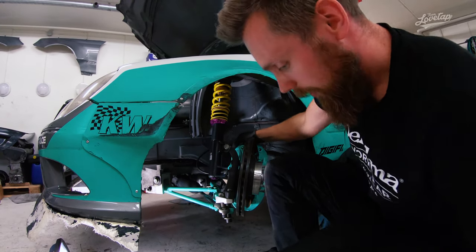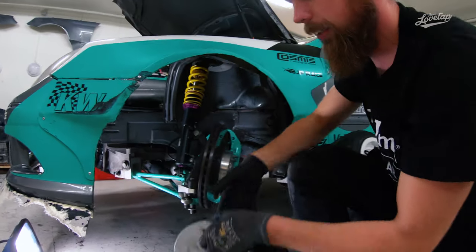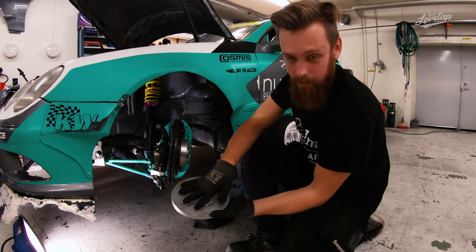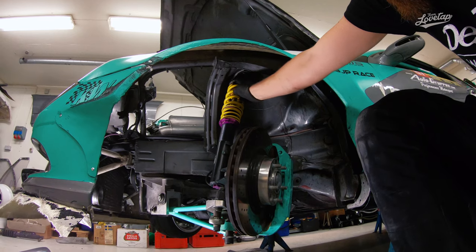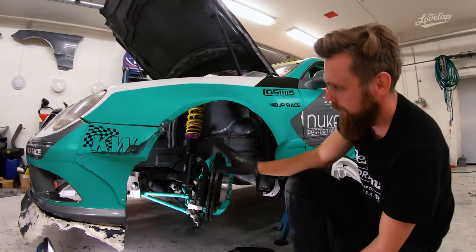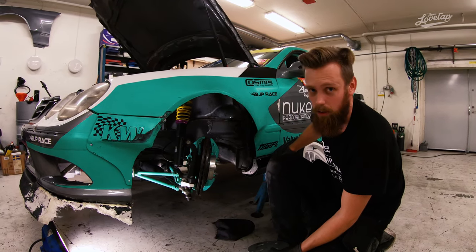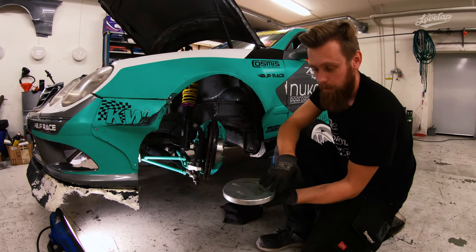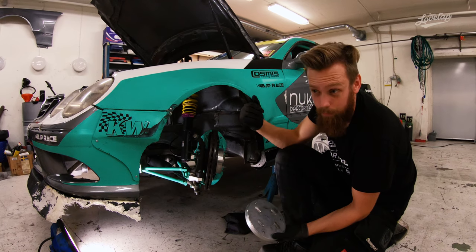We've built ourselves a completely custom top mount. I have an old version here to show how it works — it's bolted up through three holes, then we have a relocation bracket that slides in four slots, and that's what the suspension strut is connected to. We've moved it really far forward to reduce caster, because we actually moved the wheel forward compared to a stock car to clear the wheel wells in the back — it's really tight with that much angle on a 9.5-inch rim. The slots also allow us to adjust camber at the top mount by loosening four bolts and sliding it in or out, ensuring the same camber on both sides.